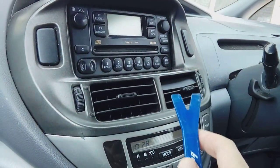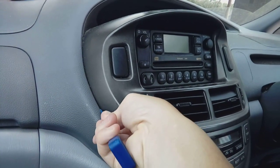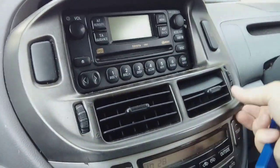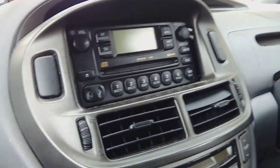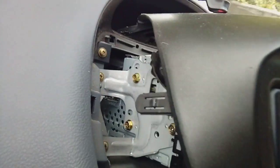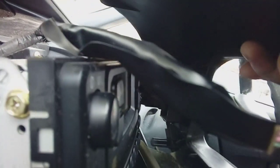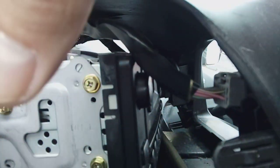The first thing you're going to do with this is insert it into the edge carefully — this is why you're not using anything metal — and then pop all the way around. This one's quite loose actually, it's been out before probably. Looking at the air vent, yes it more than likely has been out before. So just quite literally coax it all the way around, it's on clips as you can see, pull that forward slightly, and you've got some connectors for hazard warning lights and things like that. They're on little squeezy tabs, so you just sort of pinch them and pull them out.